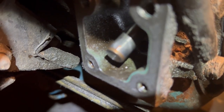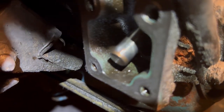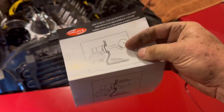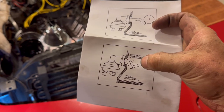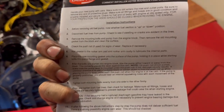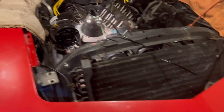What I'm going to do is put sealant all the way around that plate like a form of gasket — I hope that seals it up. Now, make sure you follow the directions that come with your fuel pump and how this lever needs to go underneath that arm. If it gets caught on top of that arm, you can mess up the pump and maybe even the camshaft. There are installation instructions with the kit, so make sure you follow them.